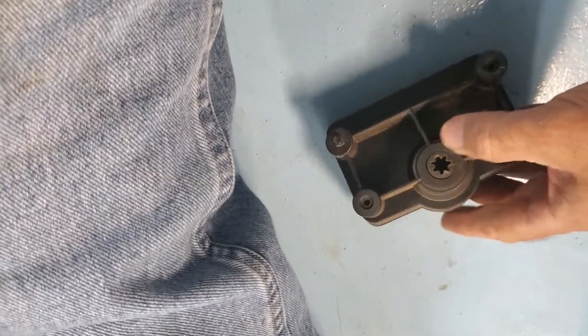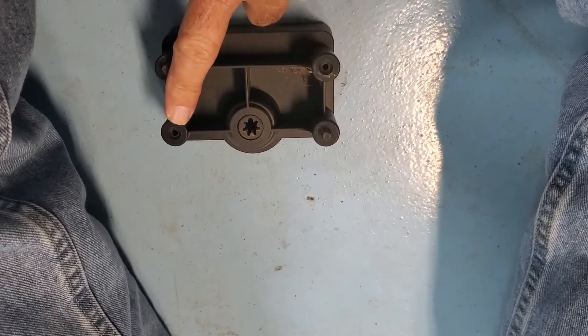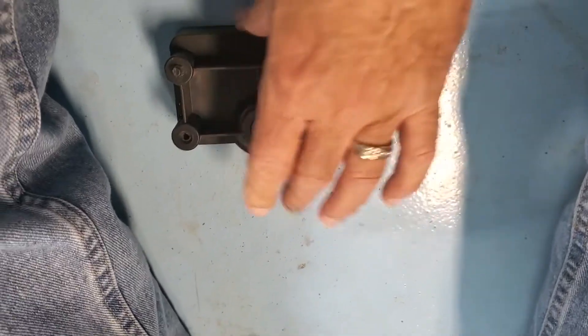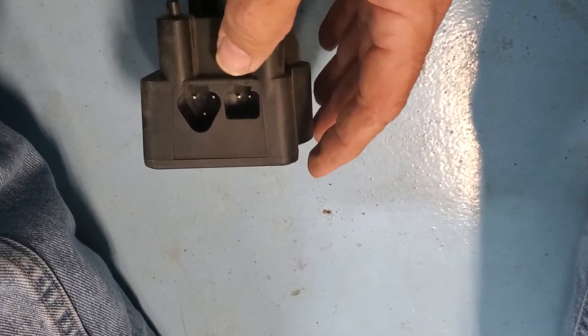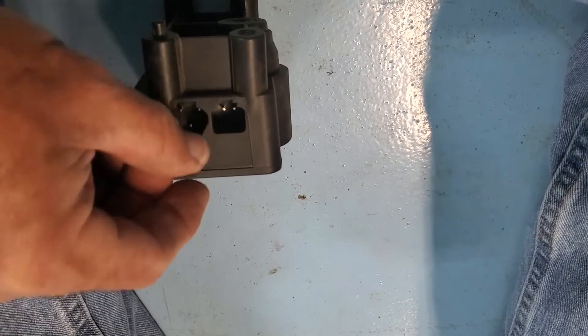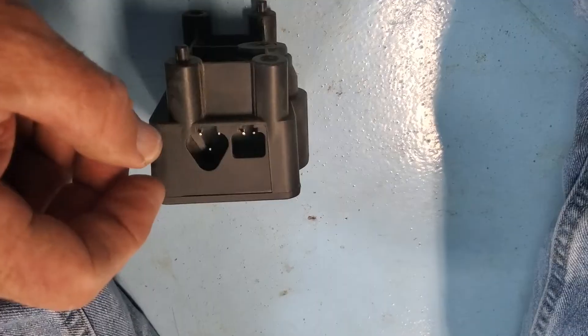Here's the one I've just taken off. On the outside it looks perfectly fine. It took about three minutes — I put a 5/16 socket on there and unscrewed the two screws. There wasn't enough room to get a nut driver in there so I used a socket. You have to push the little tab in on the plug to make the connectors come loose, but they were really tight so I had to push the tab in and work it back and forth as I pulled.